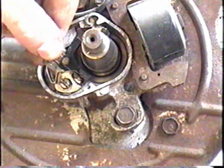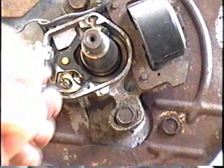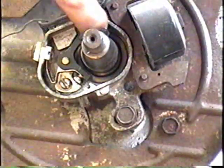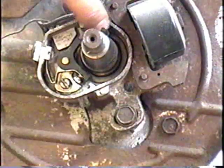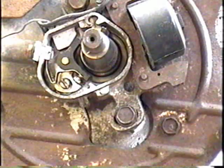You don't want it too loose in there — just snug. So I'm going to leave it like that. The gauge is just okay in there. Sometimes you can put a bit of grease on this sponge here, just to grease the lobe. Not too much because you don't want grease getting in your points.